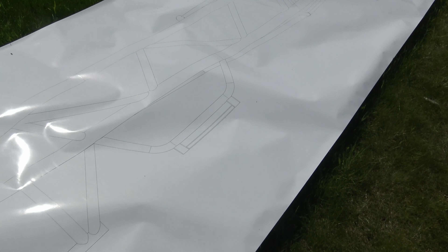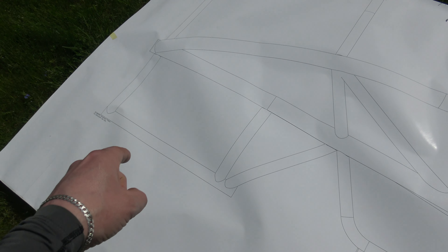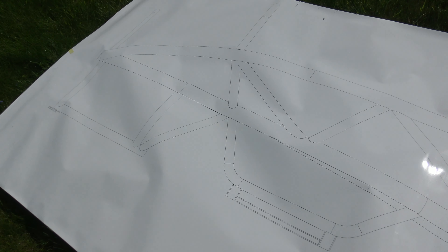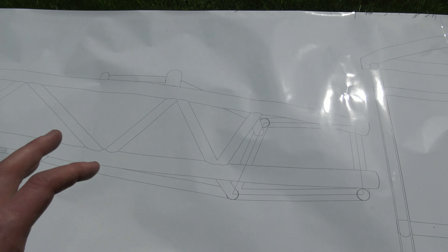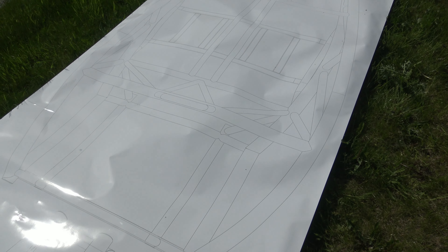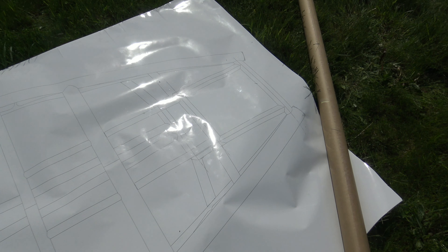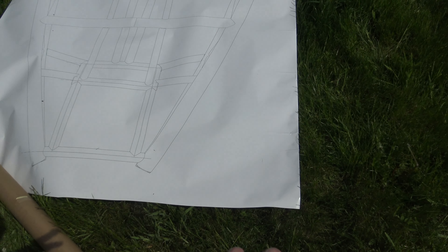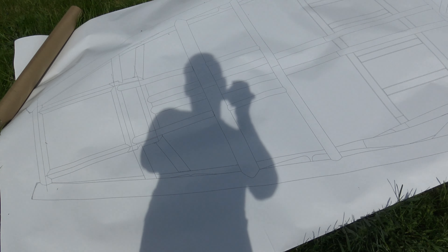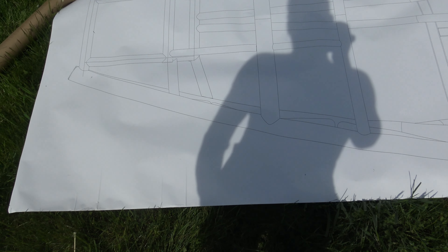We have the box at the front and as discussed the rear engine compartment. I'm planning to mount a 3.2 VTEC V6 Honda engine in the back. This is one of my projects where I spent a long time creating the model — I have all the wishbones, push rods, all the running gear, and the full assembly done. Parts created, brackets created for the wishbones, the wishbones themselves created, the push rods that go out to the struts, and the pivoting mechanism for the flat plates.